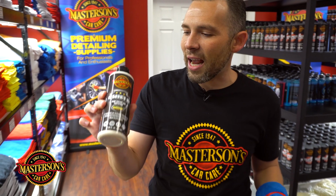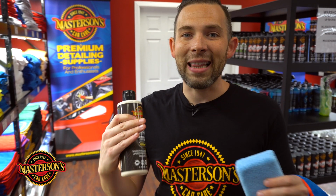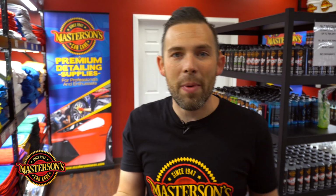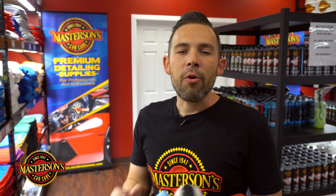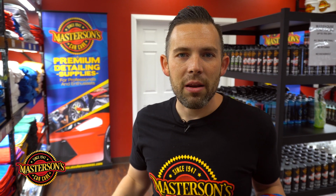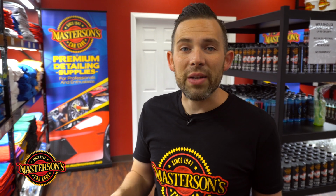So let's tell you guys a little bit about our Masterson's Shield paint sealant. Now, when you're protecting your vehicle, you want to make sure that you get great layers of protection. Protecting your vehicle is all about getting good layers on the vehicle. We went ahead and did this 3-stage paint correction on that vehicle outside using machine polishers. Right now, there's nothing on the paint. So technically, any type of dirt, dust, or misuse of a towel could scratch and swirl the paint.